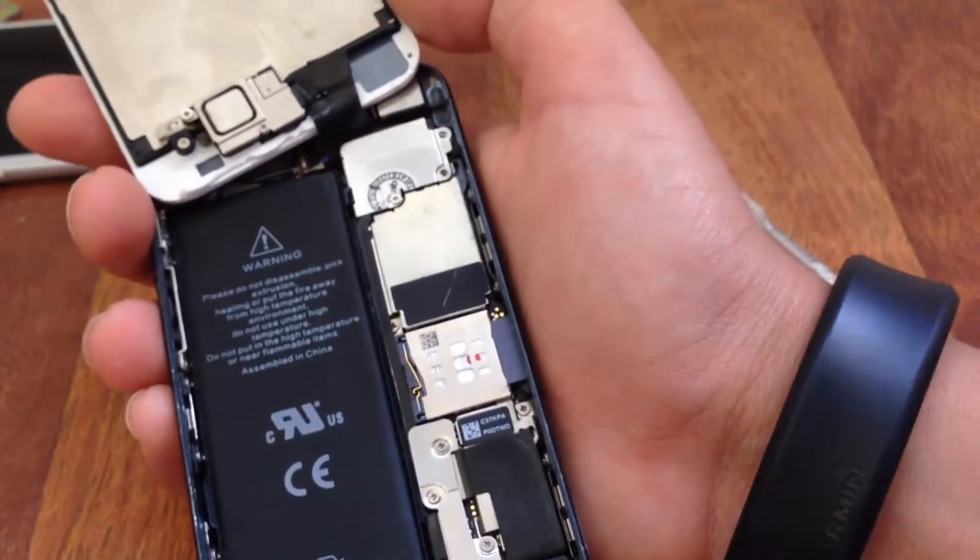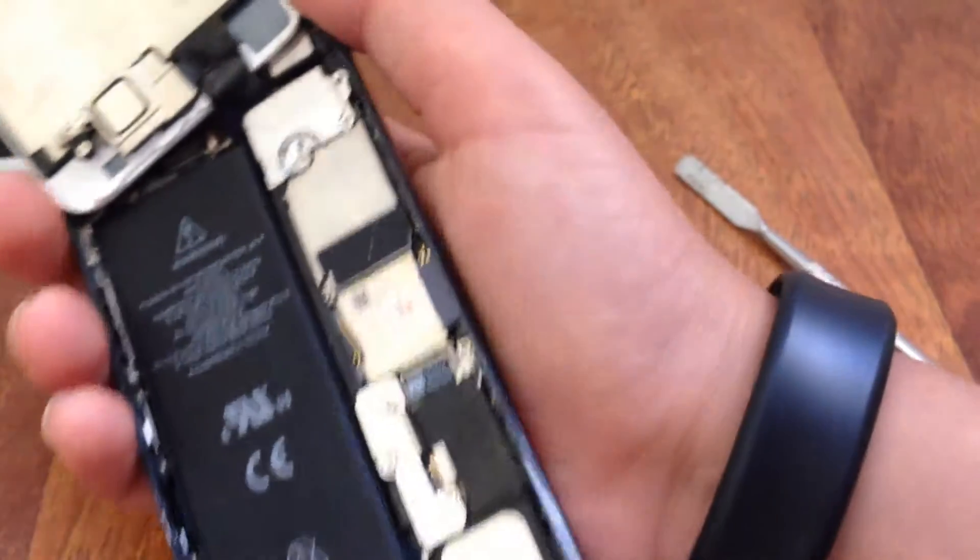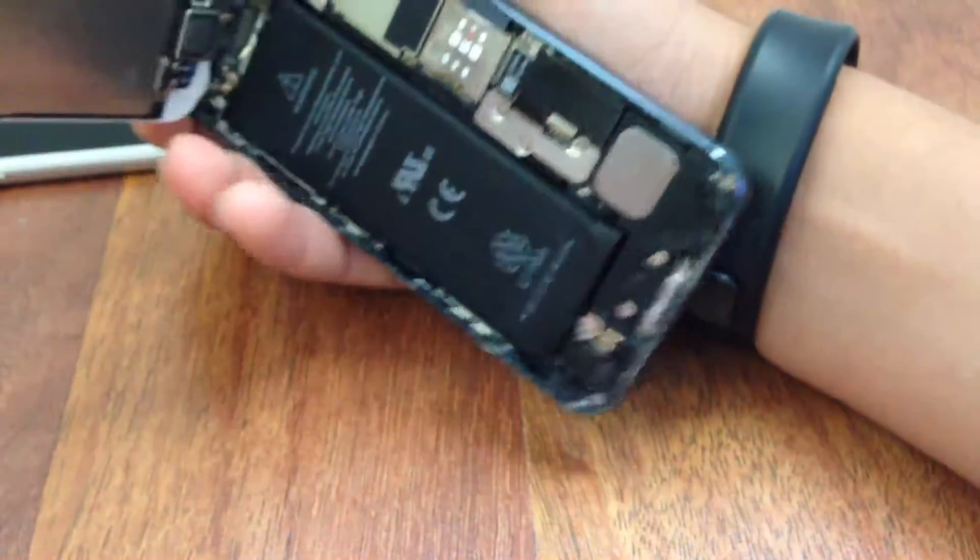That is the iPhone 5. Take a look inside — that's what all your iPhone 5s look like inside. The iPhone 4 is definitely the hardest because the two pieces don't fold out — you have to take everything out. Whereas with the iPhone 5 you just take the screen off. The iPhone 4 has a back cover and you have to remove everything to get to the screen.